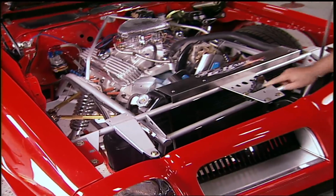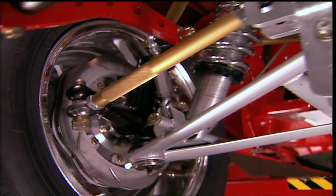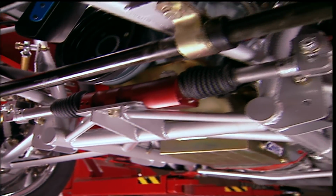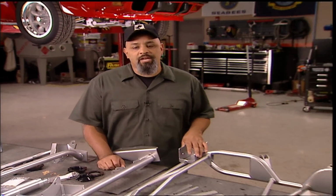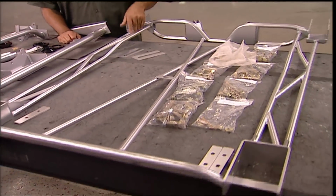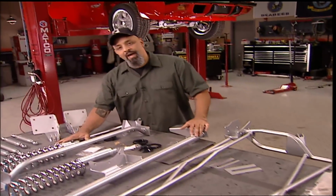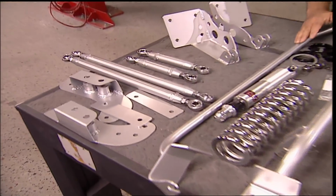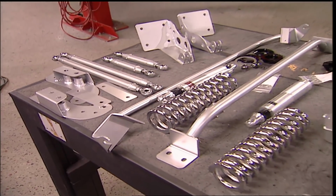It gets rid of the radiator core support so the body mounts solid to the frame. The independent suspension shares the same geometry features as their Cobra Daytona with an infinite number of adjustments. What's not on the car yet is the rest of the framing. To strengthen up that unibody design is this bolt-in subframe connector and this rear suspension package, which gets rid of the leaf springs, converting it to a triangulated 4-bar setup. Again, the same suspension geometry that's on their Cobras.